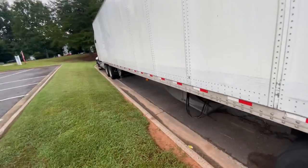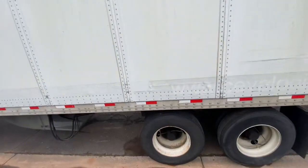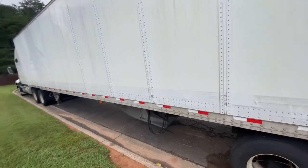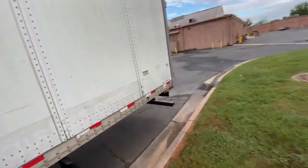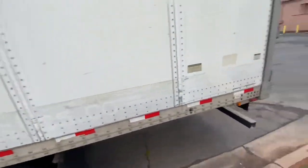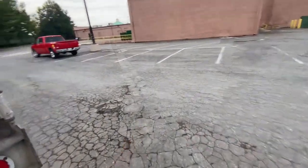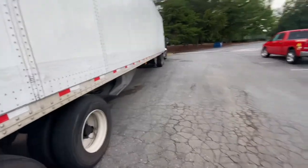Once you've unlocked your pins, get back in your tractor, release the tractor brake while leaving the trailer brakes engaged, and tug on the trailer — move it forward and back. You will feel the truck move but if you look in your mirror you'll see the tires are stationary; that means you're adjusting your trailer.